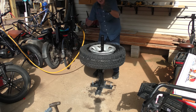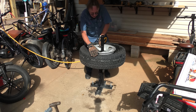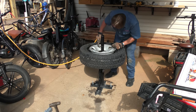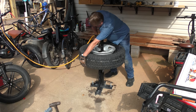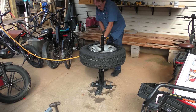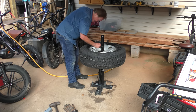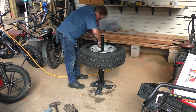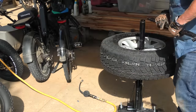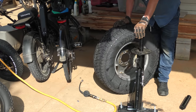Now I have an air compressor on it because I got to fill it up with air. With the valve core out the air will go in faster. You got to wiggle it with your legs to try to seal the rim — sometimes they stick. Now you wiggle them around and then finally it'll pop up. There we go, success! Then you put the stem back in and tighten it up and put 35 PSI in it. It's still on its screws — I'm amazed that didn't break too. And away goes the tire changer to the garbage can.